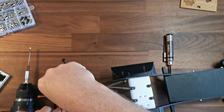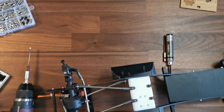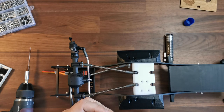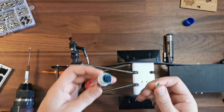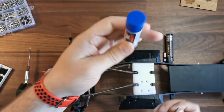I need to mount the panhard and the steering. The steering link calls for an 18mm screw and a nut, but I'm not using the stock plastic servo arm — I'm using a metal one. 18mm might be too long, so I'm going to go a little bit shorter — that's 12mm. Since I'm screwing into a metal servo arm, I'm going to put a bit of blue Loctite on there, just enough to keep it. Love these Loctite sticks.